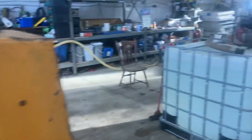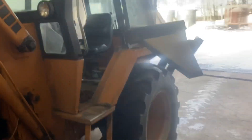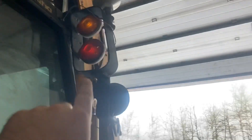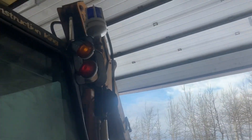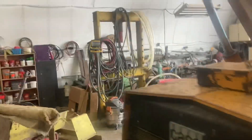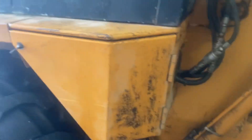Also got a brand new battery. The great thing about this - I was fortunate enough to blow up all of the lights when that was overcharging. Lucky for me, now I get to take them all out. I do not believe you can change the bulbs in these ones, so we've got to take all the caps off and change all the lights. The only lights that didn't blow up were the lights in the dash. The signal lights don't work, four-way flashes don't work, the lights in the back blew up, and the lights in the front blew up. So that alternator overcharging cost about $200 for the alternator, $180 for a new battery, and about $200 for a pack of four LED lights.